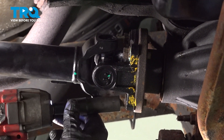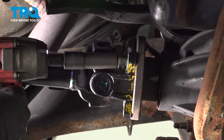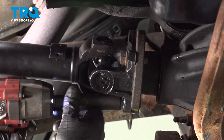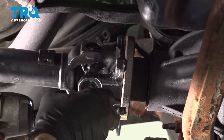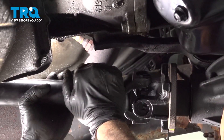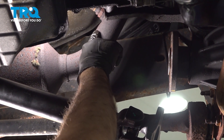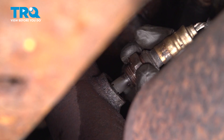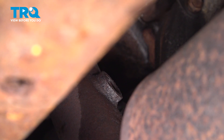Using a 15mm socket, let's go ahead and loosen and remove these bolts. Be careful with that drive shaft — make sure it doesn't slip down and bonk you in the head. Go ahead and let that come down; that's going to give us easy access. We're going to continue to unthread the upper O2 sensor until it's completely out. Once you loosen it with your wrench, pull it out. You can disconnect the connector or tuck it up into another harness so it doesn't fall down and hit anything.